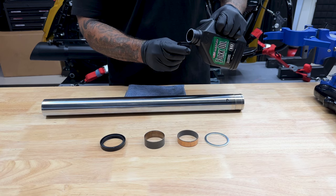I'll throw the top cap of the cartridge into the fork tube. When you're threading this in, just apply some pressure and make sure you're not cross-threading. Here I'm using a spanner wrench to tighten it the rest of the way — I just taped up the ends so I don't damage the fork cap. There's no torque value on these — you're just going to turn it until it stops. You can go off your service manual for the torque value on your fork tube plug, but these are a little different. Just get it down nice and snug until it stops.